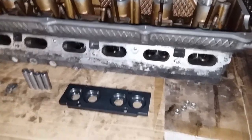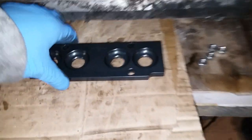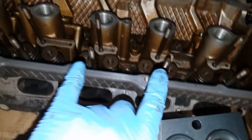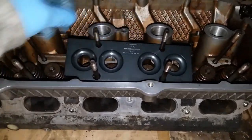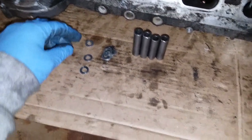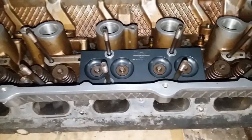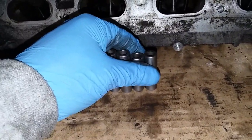Alright guys, we're here at the cylinder head now and I'm going to show you how to use this tool. Here is our beautifully designed valve spring compressor — you can see their awesome logo imprinted on it. We're going to go for these four valves right here. Take our compressor and set it in here, right over the studs. There are the tops of our valves. Then we're going to take four washers and place one over each stud. Next step is to get your spacers — there are two different lengths.